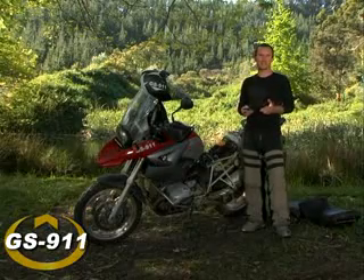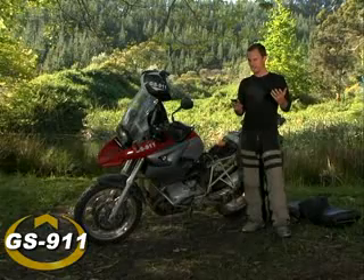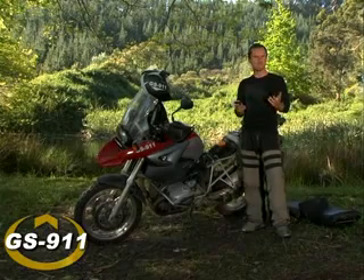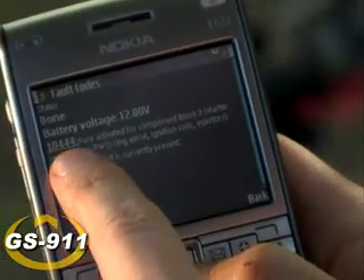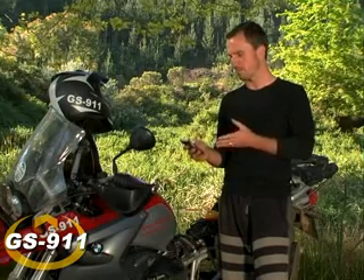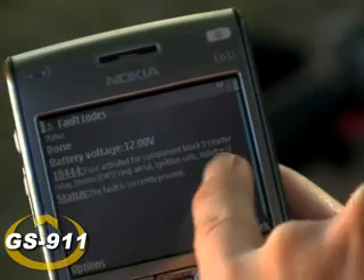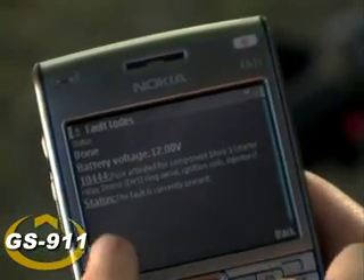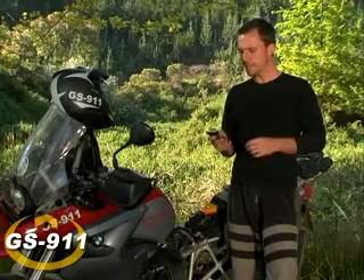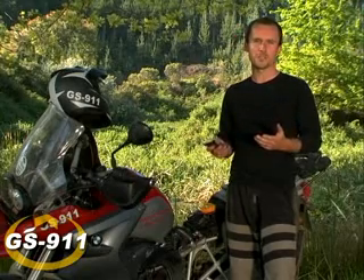Let's now take a look at the fault codes. Simply hit Select and go through the same procedure — check the ignition, neutral, kill switch, alarm immobilizer, and hit OK. And there we have the culprit: fault code 10444. The very handy thing with this tool is that it doesn't only give the code, but it gives a very concise description as well. In this case, you can see that the fuse is activated for component block 3, which drives the starter relay, immobilizer, ring aerial, ignition coils, and injectors. The key question is: how do I isolate the exact component which is to blame for this fault?